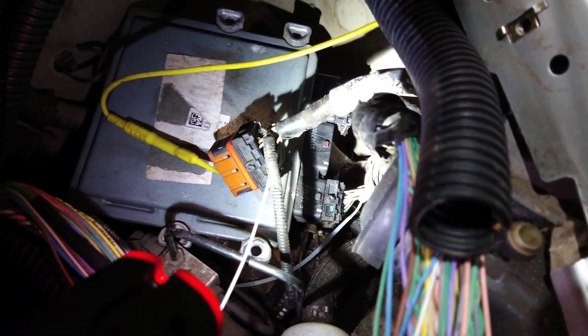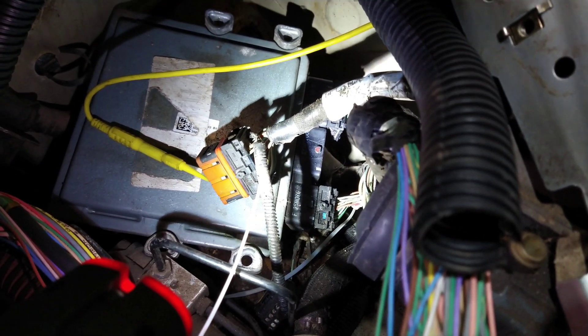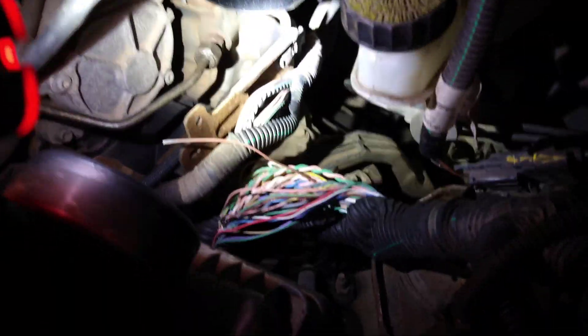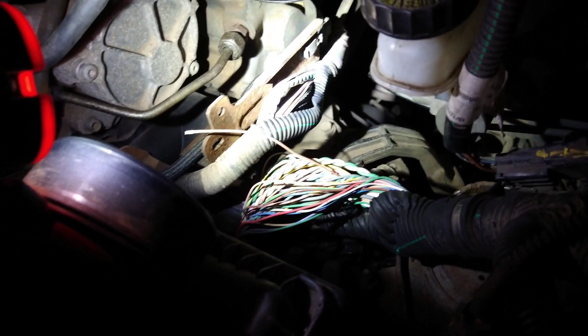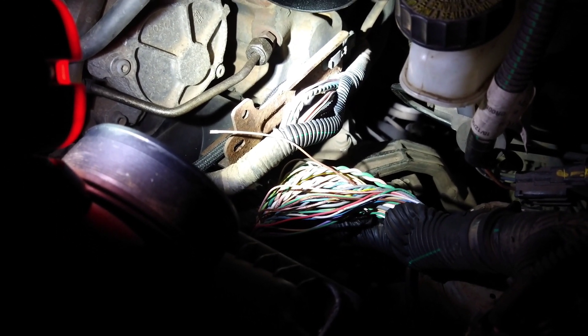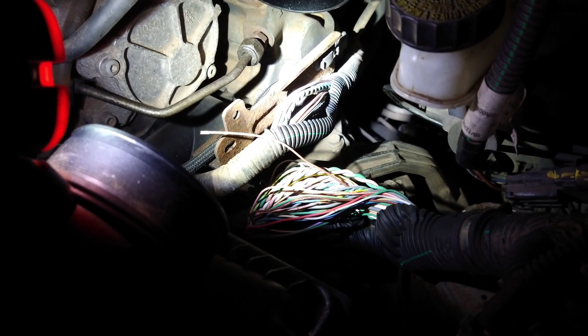I was asked whether I could just join it with the jumped fuse wire as a permanent fix. If it was going to be too much of a pain I would have done that, but I felt better knowing exactly where the wire was broken. In this case I found it pretty quickly, so I'm glad I went ahead and checked. Now I'll join that together and check the other wires in that area.